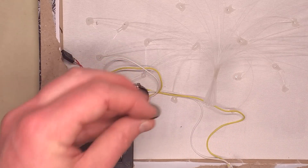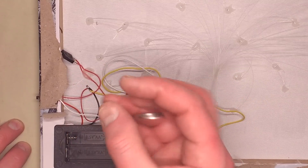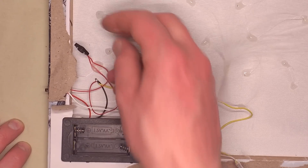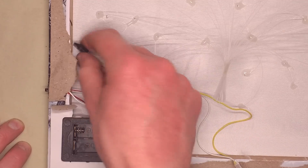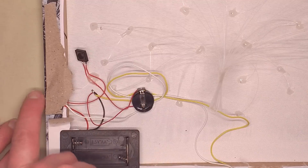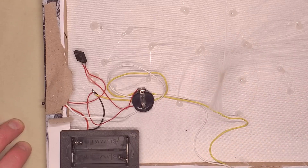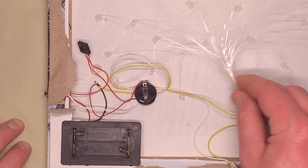It's just a single cell — I thought it might have been a stack of two for extra brightness, but it's just a standard CR2032: 20 meaning 20mm diameter and 32 meaning 3.2mm thick. The switch just shunts this little lithium button cell onto the LED via the button, and the switch connects the AA holder onto the same LED. But without the button, they're just two completely separate sections feeding the one LED. So that's quite neat.